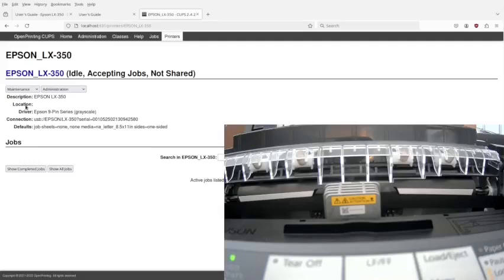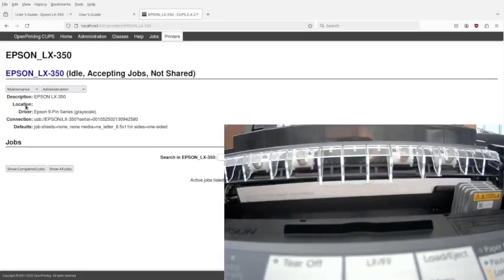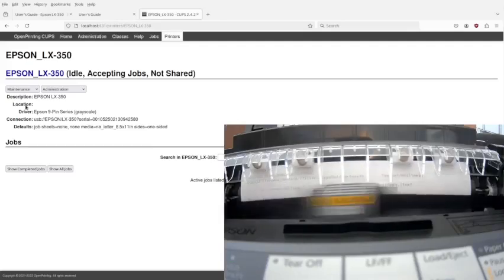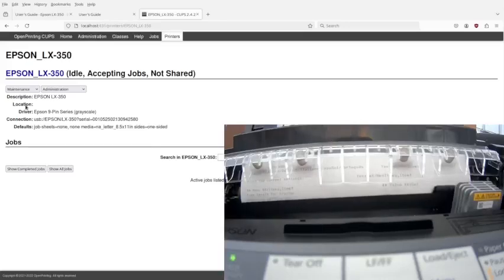Let's go into the menu and turn off that low noise. And then we take English. Do we want to print the current settings? No. Page length 8. Skip the perforation. Auto tear off. You can see here now we're getting a little bit more of a normal thing. It's on the edge of the roller. So that's interesting. It said to set it to 0, but it's really not 0. You almost want to be to the left side of this arrow rather than where the arrow is pointing, which is like 5 in terms of whatever setting they're at.